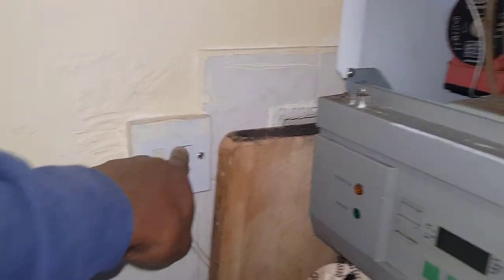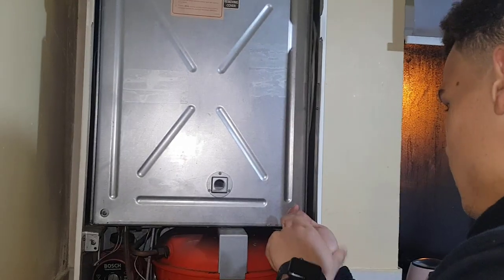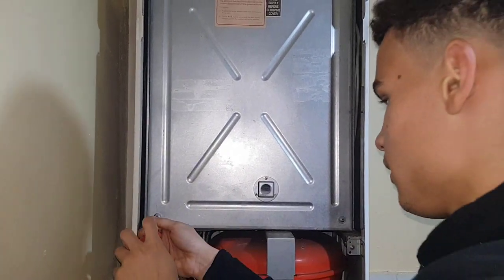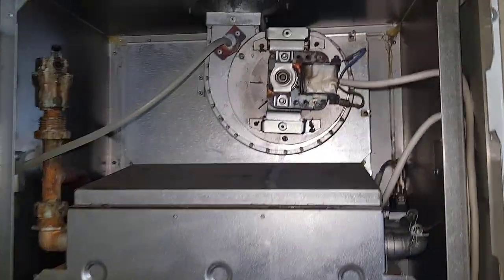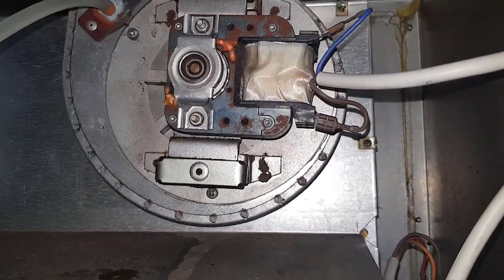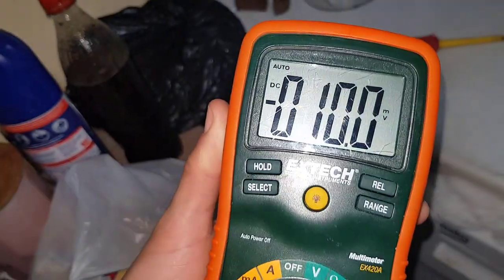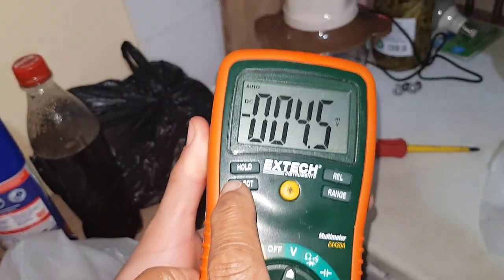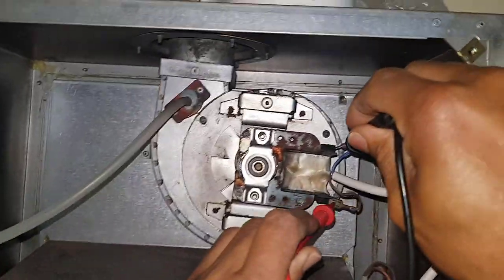Making sure that they're 230 volts. So we'll turn the power off and remove these four screws, get inside there and look at the fan. So this is the fan here. What we'll do is test across this connection — the live and the neutral. We're going to put the multimeter on AC.